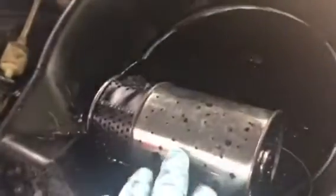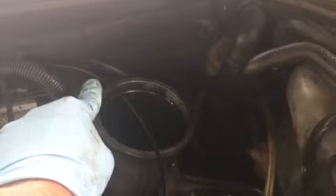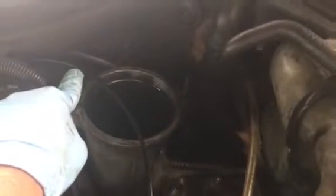And then if you're doing the oil filter, you come up here. This is the oil filter that I pulled out. So this is the filter, and it sat down in this oil filter housing. So first things first, you want to pull off these two nuts that are on these studs. Those are also 13 millimeters. So you pull those off, and when you reinstall, those are to 17 foot-pounds of torque.